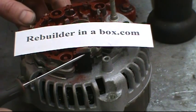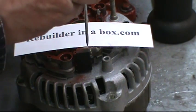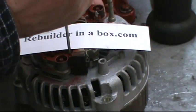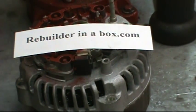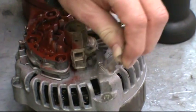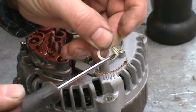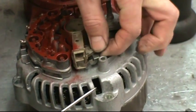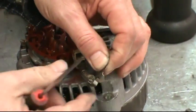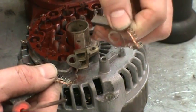Now we're going to change the brushes. You'll see a black plastic cover with a hinge-type clip on both sides. Reach in and take the clip loose, then work both sides off and remove the whole clip. Now pull the brushes out. Notice the top brush has a line-up pin and is the bigger hole of the two — the smaller hole is the brush that goes on the bottom, the bigger hole goes on top.